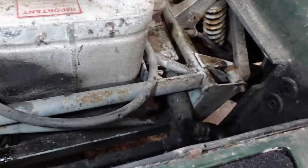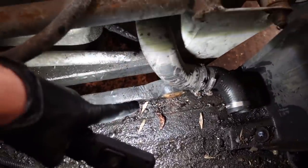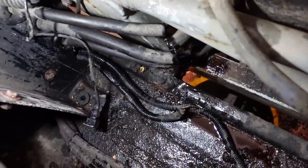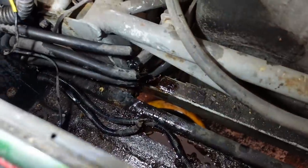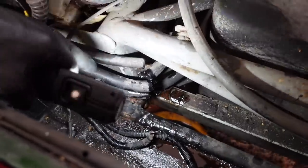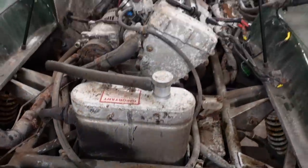I think I'm just about done with the front end. The radiator and condenser are both removed, which made a load of mess. I've removed an earth strap from the chassis and a few plugs for the radiator. The chassis body bolts - one on each side - both snapped off. I also have power steering here with two hoses; I've actually just cut them because there was nowhere to really drain the power steering fluid from, the connectors were all rusted solid, and I'm replacing all these hoses anyway as they're perished. I'm pretty much done at the front now and can't see anything else stopping it from coming off.